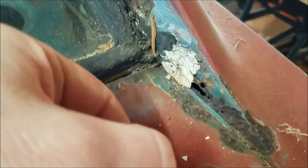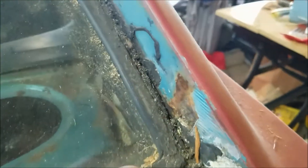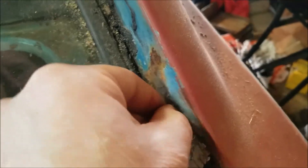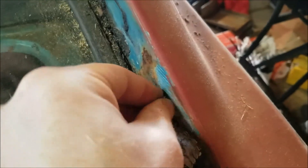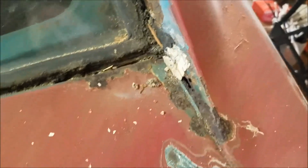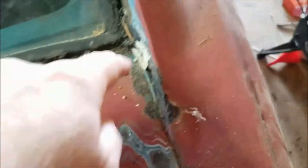That was how some of the water was getting into the back, but the rest of the panel looks decent. I'm just going to tear the rust out of that. That's not sheet metal — that's flexible. That's putty. The sheet metal underneath the putty looks somewhat decent, a little bit of surface rust. I might have to just do a little patch right down in that corner, but nothing to replace there.